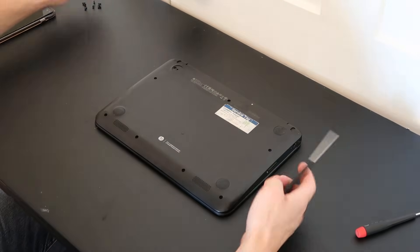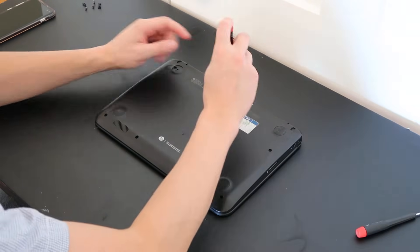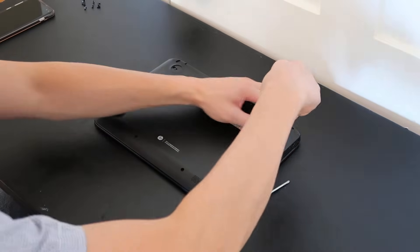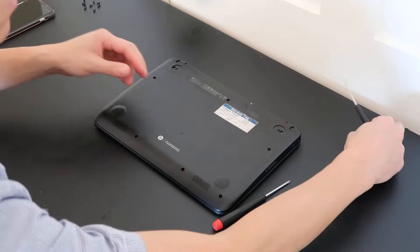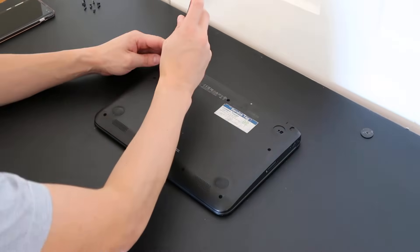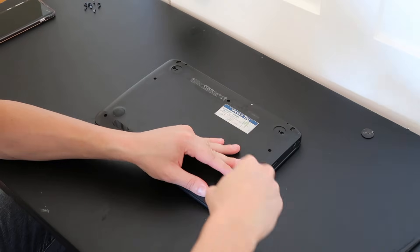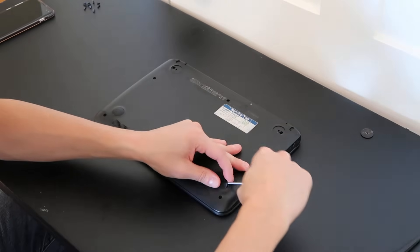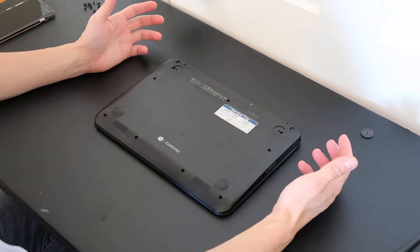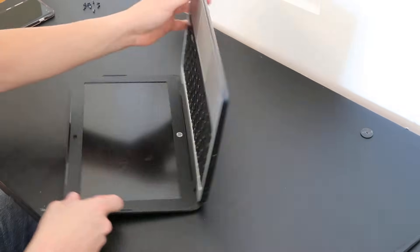You can see there were two rubber feet here and I've taken off one. There's a screw underneath it, so keep in mind you may need to remove some rubber feet to get at screws underneath. Check the other side too — depending on your exact model it may be different. I use a little flathead screwdriver to get under them. They're usually held on by double-sided tape or glue, so they'll go right back on afterward.